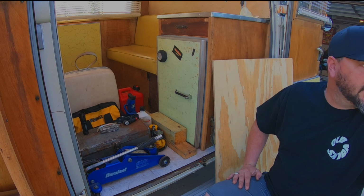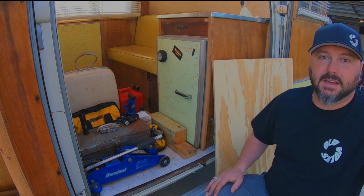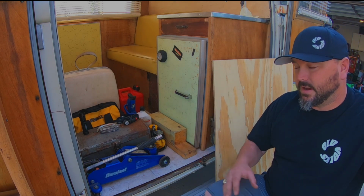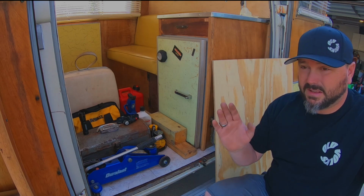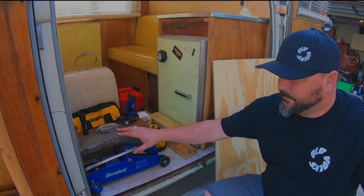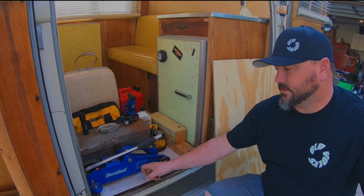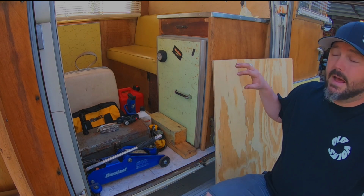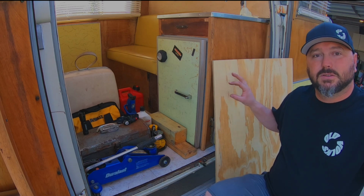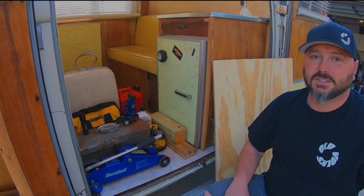All right, so one of the most important things to have, just because it's going to come in the most handy out of everything else, is a good jack. I don't use the stock jacks. I don't trust them. They're wobbly, they're unstable, and rusty jack points and things like that, no good. So I carry a good Harbor Freight or auto parts store, just a regular floor jack, and then carry a piece of plywood to roll it around on. Gives you a nice stable platform to position it wherever you need to under the car. It's not going to sink or be sketchy at all.